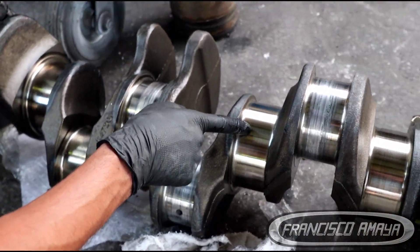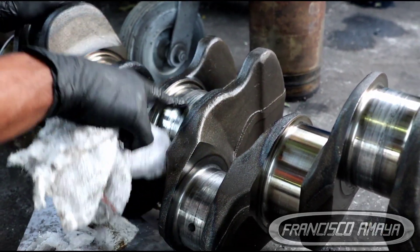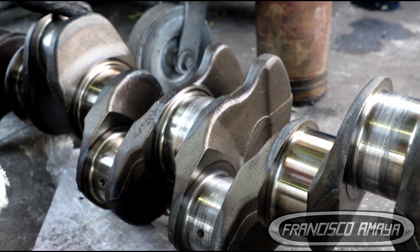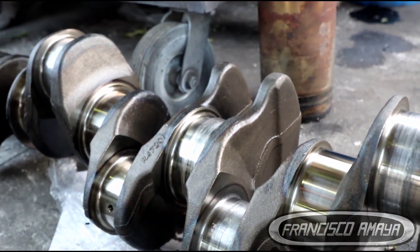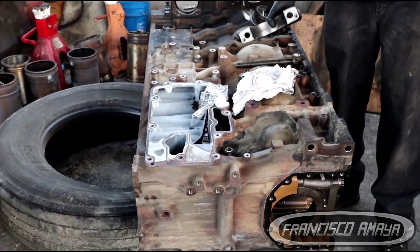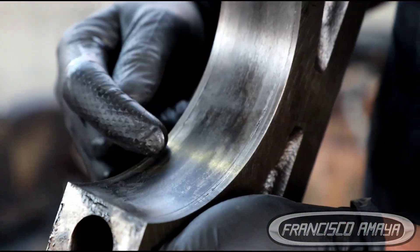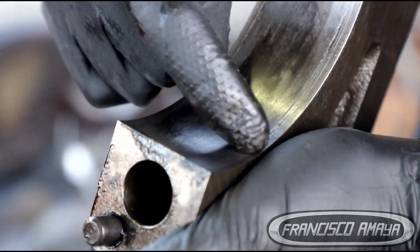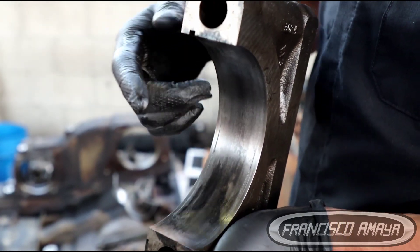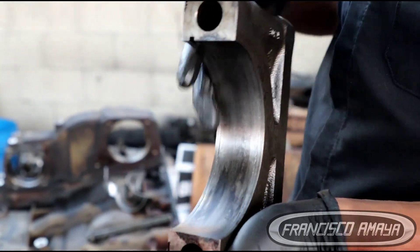See how clean the other bearings look — super nice. But this one right here destroyed the whole engine block, though we can fix it. Here is the main bearing cap, and you can see the damage that happened to it. When the bearing spun and rotated at the same speed as the crankshaft, it actually damaged the contact surface of the cap.